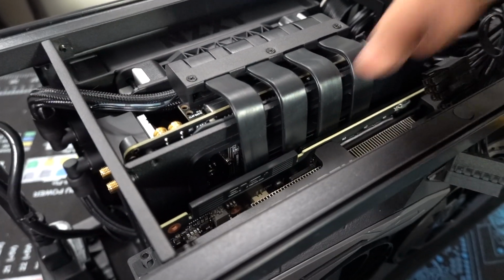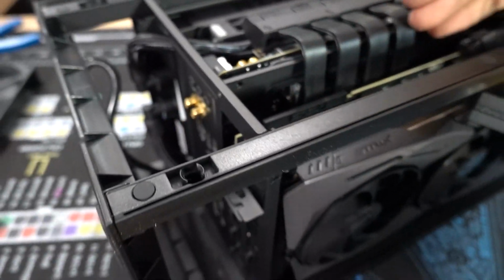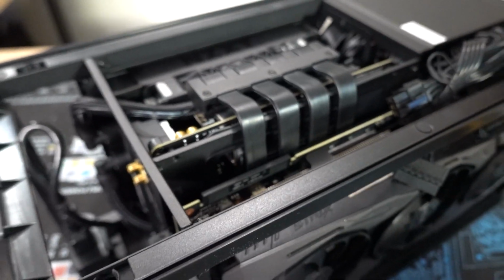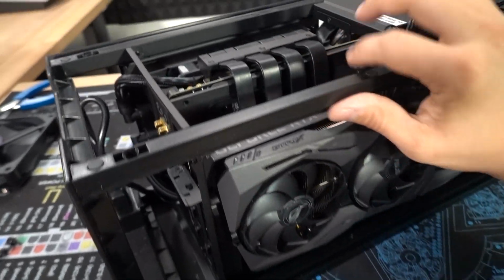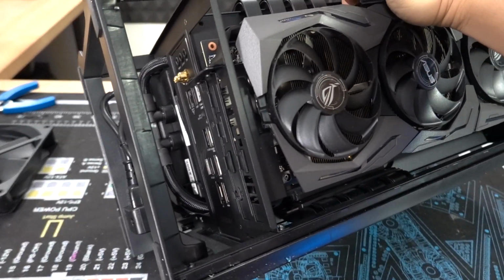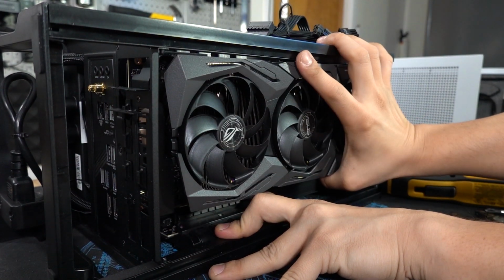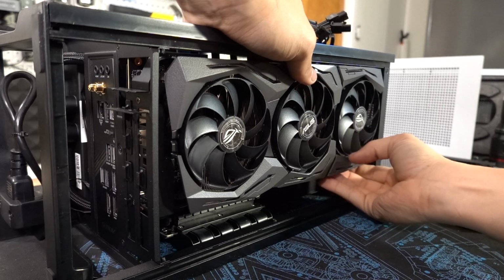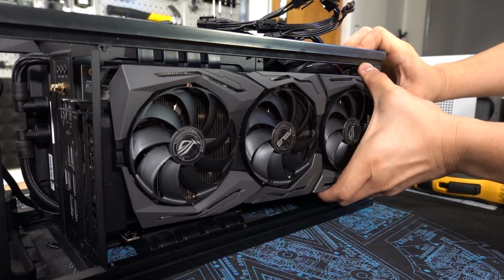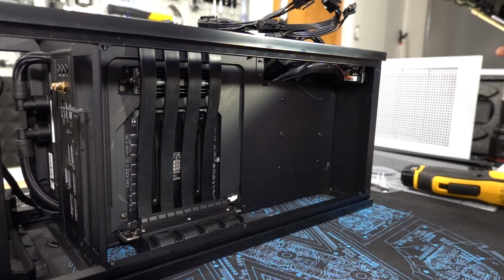I'm sorry guys, I don't think we can have that M.2 drive in the back. Obviously we could just remove the heatsink and it would clear no problem, but then we risk the drive overheating and thermal throttling, especially being right up next to the GPU. Not the best place to be for something like that. So I'm going to remove it. That's the tightest fit GPU I think I've ever had to deal with. Did I box this in? There's a way in, there's a way out. Oh, I got it. That was scary. I didn't think I'd ever see you again.